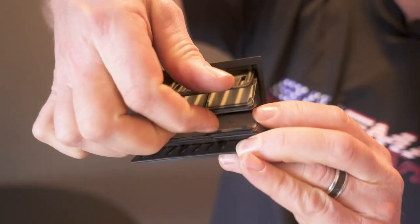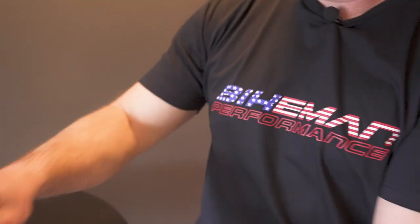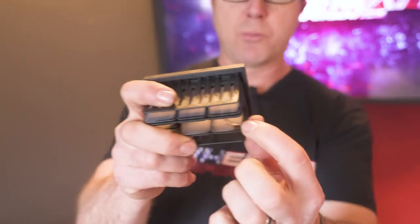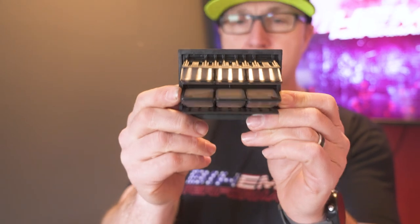You can see if the center is opening and the outside isn't and it tries to bend, you can't bend a single plane in two different directions at the same time. Since reeds are a hard material, if you start doing that, eventually you'll start cracking on the stress line, which is that angled portion right there that you see on this reed. So if you've seen a boost reed broke, that's how it's broke.